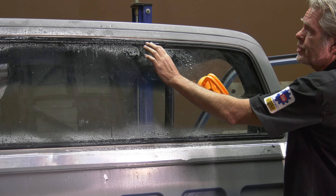This one was really stuck in here — I actually had to cut along here and on the inside too, but now it's about to come out. When trying to get it out, I'm going to tap on the glass with a full palm. I want to make sure I don't have any specific points because a specific point might break the glass. So just tapping on it like this to encourage it to come out. And since we have the bottom not totally cut out, it's still stable — I can just pull it on out.